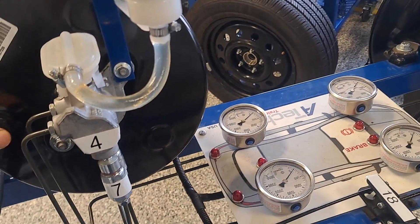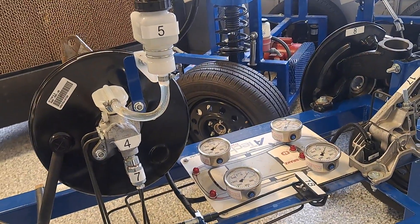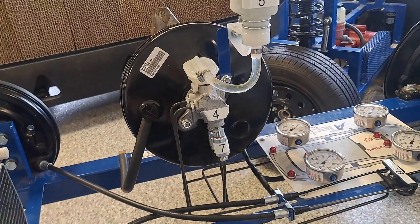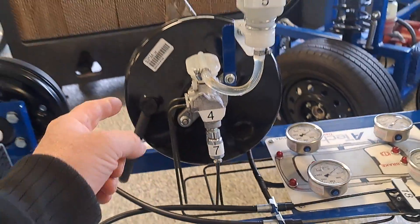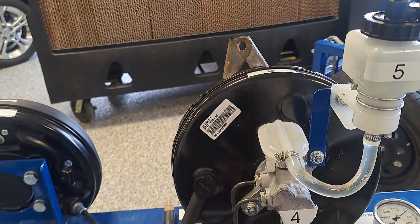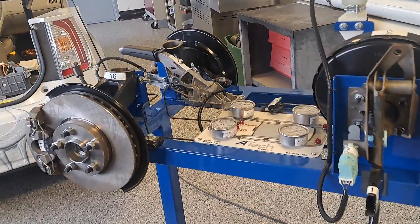You need at least two to three good pedal pumps of brake assist before the pedal gets hard — that's why we have a check valve. To do a safety check: start the car, build up vacuum, then turn it off and wait about five minutes. Step on the pedal and you should still get good assist — the pedal going down is a good sign. If you turn it off, wait five minutes, and the pedal is immediately hard, that means the booster is leaking vacuum, and the most likely culprit is the check valve, which is the most common failure point. Hopefully this gives you a good overview of the system.